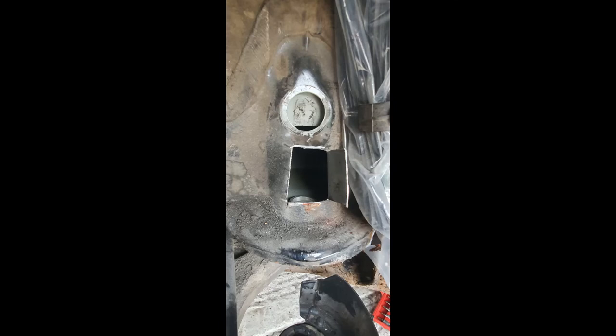Once you've cut away the rubber, you're going to need to cut a hole in the car — not a very big hole, just a little doorway as I call it — so you're able to feed the airline directly on top of the airbag itself. You'll see there's a circular hole with a grommet there; you take it out, feed the pipe through the grommet, and then feed it directly on top of the airbag itself, as you can see in the picture.